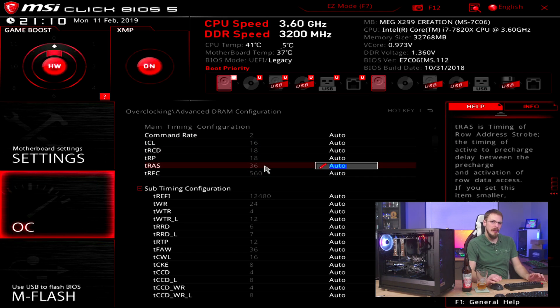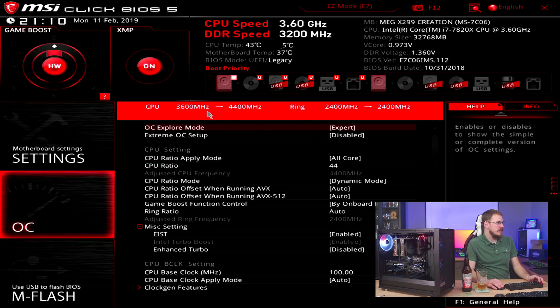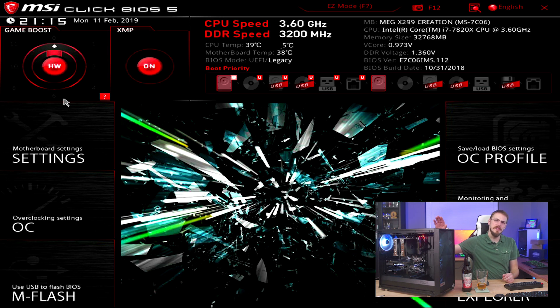For my intents and purposes I'm just going to leave it there. If I wanted to dial in a manual overclock for my CPU, I do that right here at CPU ratio — so let's say I wanted to go to 4.4 gigahertz, I type in 44 and it changes from 3600 up to 4400 megahertz. If we scroll down, you'll see CPU core voltage where we can manually set that as well. However, I'm going to do this one better and let the motherboard set my overclock for me. There's actually a physical dial on the motherboard which you can turn up to 11 — it actually goes to 11. I can also invoke that via a software-based button right here. We're going to go to number two, which is a 4.5 gigahertz overclock for a 7820X. The overclock numbers for this dial are indicated in the user manual, so make sure to check that before you start spinning the dial.